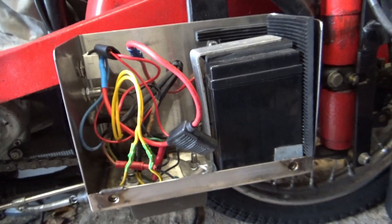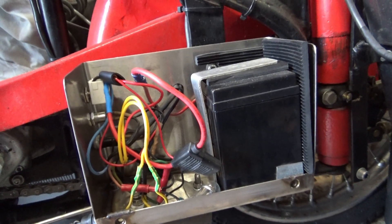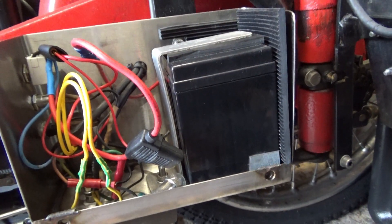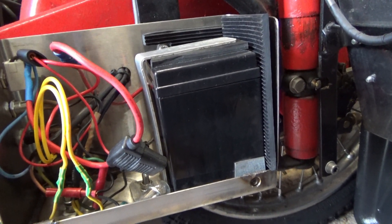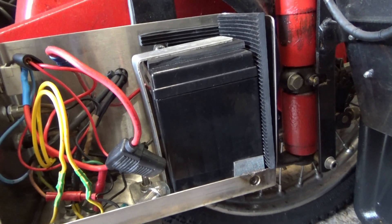This is my little battery box, bolted to a bit on the frame that I welded on. I know the Bantam Owners Club are going to hate me for that, but I don't care. This is a 12 volt battery out of an alarm system — only a little one. Doesn't need to be a lot; it just helps smooth the power supply a little bit and gives me a backup as well.